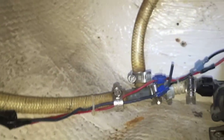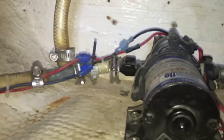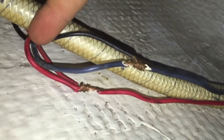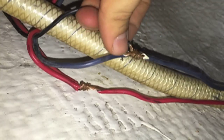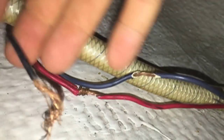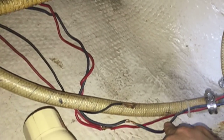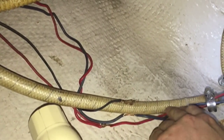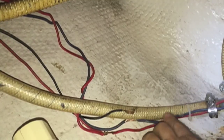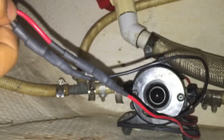He had the DC outlet just spliced into the water pump wiring. He just pulled away a little bit of the sheathing, wrapped the wire around it, and put some electrical tape over it. Anyone would have plugged into that DC socket without knowing it was sharing the water pump circuit. If I did an energy audit and said this is pulling eight amps, whatever they were plugging in would be on top of that eight amps — so if I had it fused for 10 amps, that's really dangerous. I got rid of that ridiculous splicing.